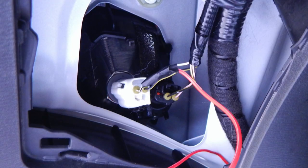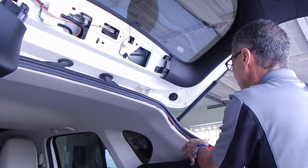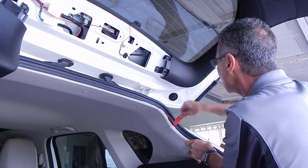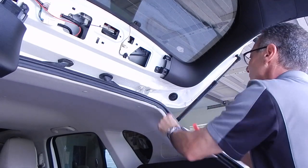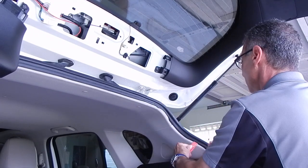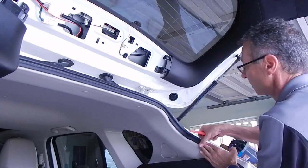Just be gentle — you don't want to break any of those. Here you can see I've actually tied into the power wire that goes to the backup light. You can either use heat shrink, solder it, or as I did, just strip the wire back a little bit, wrap it, crimp it, make sure it has a really good connection, and put some electrical tape around it.